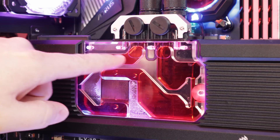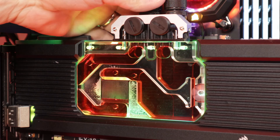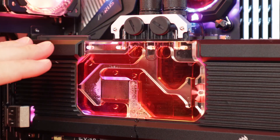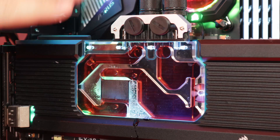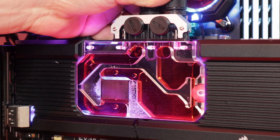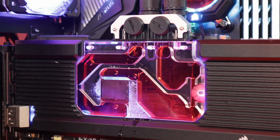It's the XG7, I believe. At the top you've got two bolts that fasten this manifold on, and that's where the problem is. When I put a little back pressure on this, it starts to leak — it leaked a lot more than I thought it was going to. Essentially, you're okay as long as you do not put any pressure on your manifold, but if you have a tight cable run and move it a little bit, it's all over. So we're going to take all this out and go with EK, because that is just unacceptable.